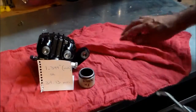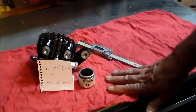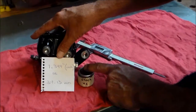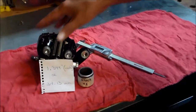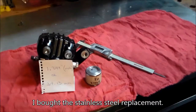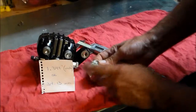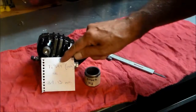If you're going to rebuild your stock caliper, there is an issue you need to be aware of. This dimension, as you can see here, is what the stock H1 caliper piston should be — 1.344 inch or 34.13 millimeter. When I bought my replacement piston, someone told me to check it because it might be a little long. Sure enough, it was — about a sixteenth of an inch longer. So please make sure your replacement piston is the correct length.